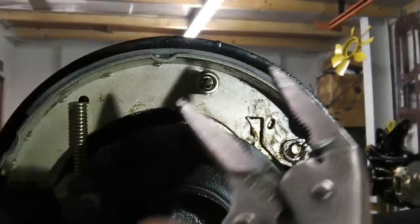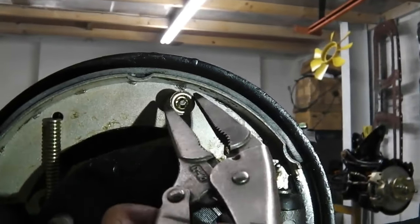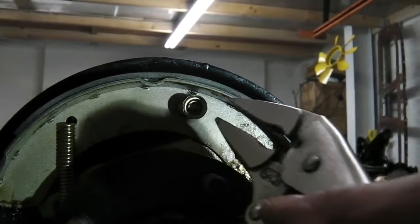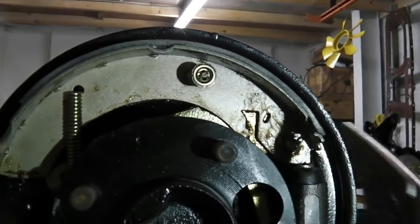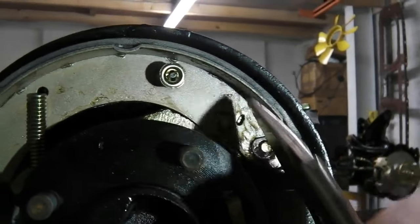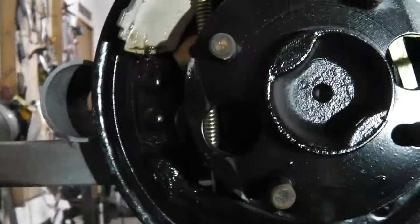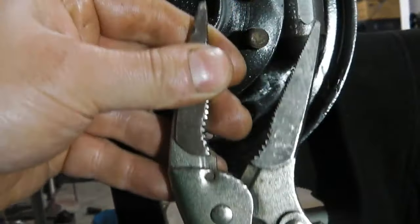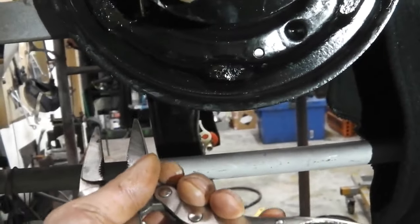So what I used them for, adjusting on the pressure adjuster thread there, I can lock the collar like this, grab it nicely in the pliers, put my finger at the back, and I can just use this push and turn, and we can get this top assembly on with the handbrake adjuster already fitted on the horseshoe. So add that as an assembly, then hang your spring on it there, and now we'll move on to the next stage. So we don't need long nose pliers just yet, but I'm showing you that they're a great tool for that, and we're going to use them for the spring in a minute as well.